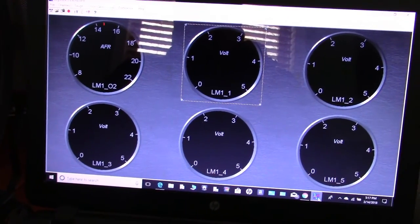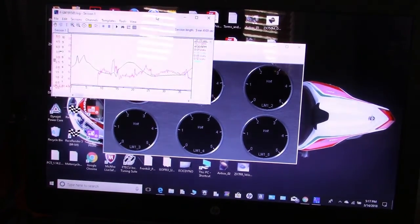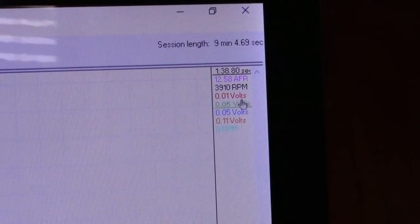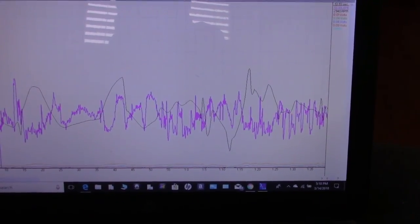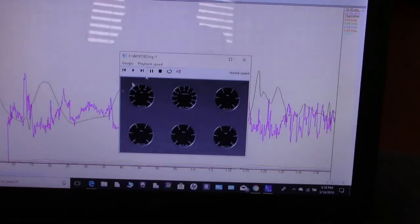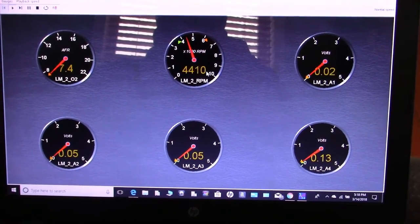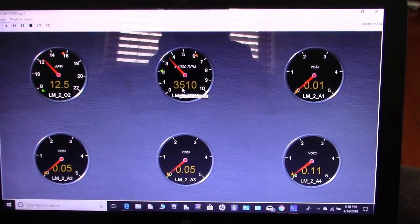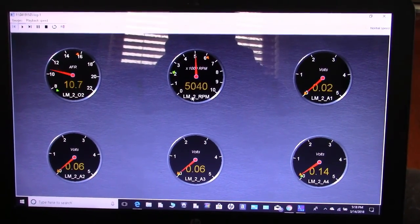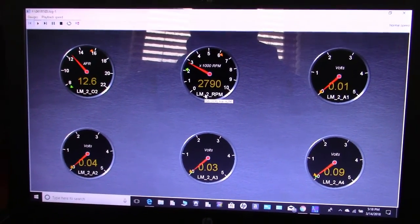Basically you're going to point it to the SD card and here's an old file. If you put your cursor over it in the upper corner, you can see your air fuel ratio for a particular RPM. These graphs don't seem to have any smoothing, so what I like to do is just play it and then you'll get the gauges. This is an old file that was already on the SD card when I bought it used, so this is someone else's file, but it's going to show the driving RPM and the air fuel ratio for a given RPM. When you record, you want to make sure you're holding the throttle steady at various points — 2, 3, 4, 5, 6,000 RPM.